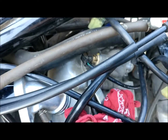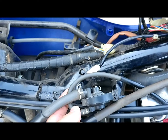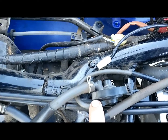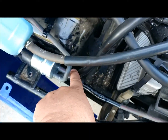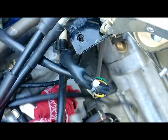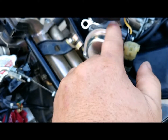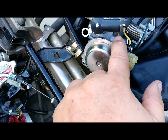This line right here, if you follow and trace it - you can ignore my bandana, that's just so I don't drop anything in the intake - it comes all the way up here. I don't know what this thing is, but as long as you get it hooked up right, that's all that matters. It snakes around and comes right here. This thing here has a line that goes down off into La La Land and there's another line. It actually is this line right here and I've got that marked as 'top carb.' So this line that comes straight down from this device - this is underneath where your seat would normally be - it's going to go to the spigot on top of the carburetor right there. That's where that's going to go.